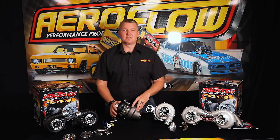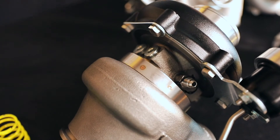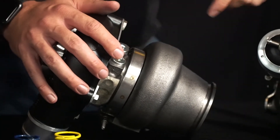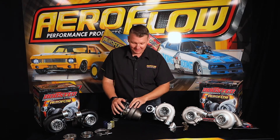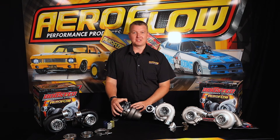One of the last key features of this range is that the core is a dual ceramic ball bearing core that is oil lubricated and water cooled. The core has multiple water ports, so you can vary the way the water passes through. Coming back to compact packaging in modern engine bays, sometimes it's difficult to run a water line from one side to the other — with this design, you can actually run the water in and out from the same side. You just need to make sure you plumb it up correctly. We're always looking to make it more flexible and easier for everyone to package these into their new project builds.